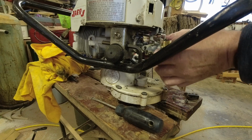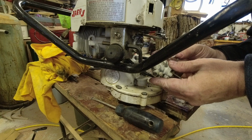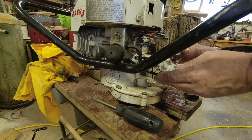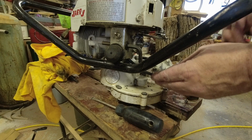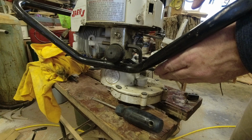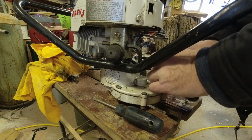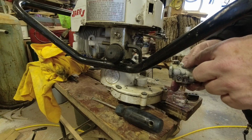This is the governor spring off of the throttle. Pulling on the throttle lever doesn't directly increase the throttle on the engine. It just pulls a little bit on this lever, which has a wind vane that goes up beside the fan that's underneath this cover. That kind of works as a governor to set the power. This is our idle screw.